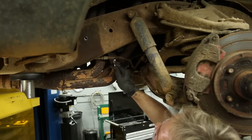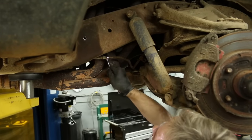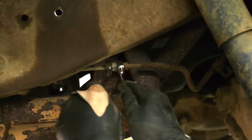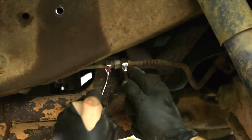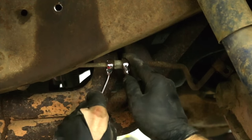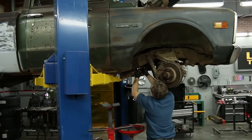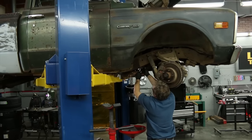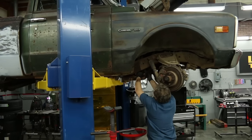Here's the union we need to keep, and this is where your line wrenches come in handy. We want to keep the flats intact so we can reuse this piece — your line wrenches will do exactly that. We're finally getting some brake fluid out of the brake system.